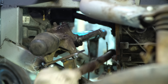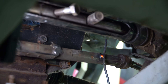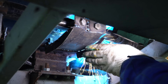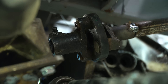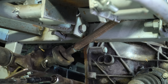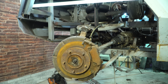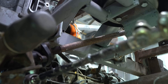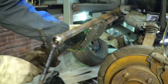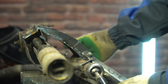The scheme will be the same as before — I'll use a crossbar with track rods. That's not the final version; eventually I need to find a normal steering rack. I set the crossbar relative to the steering rack and welded the mounting bracket. The configuration turned out to be quite dense. The steering shaft will be passed through the suspension arm. Now the bracket needs to be reinforced. From the other side, I welded another slab to fit the dust cover. I guess initially such a rail will be quite enough.